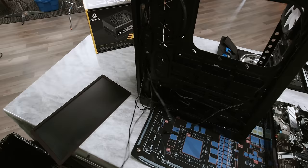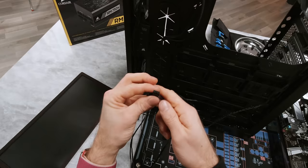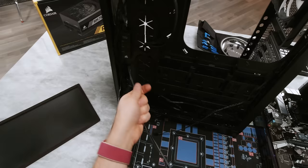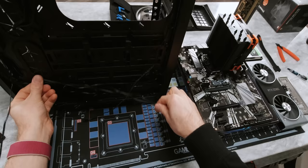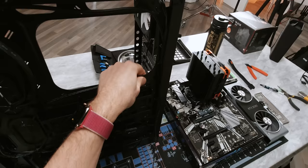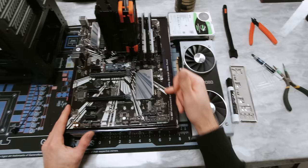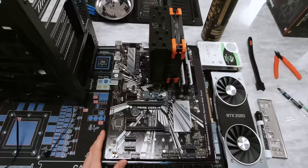What I'm doing right now with the fans is I'm kind of untangling the wires, making it so that my RGB wires and my power wires aren't crossing each other — because the RGB ones are both going to go to the same place down over here in the bottom right, and power is actually going to come up across here. This is really important before you install your motherboard — you're going to want to scout out where the fan power connectors are on the board. I like to see them along the bottom edge here or the right bottom edge here, as that makes it particularly easy to install bottom or front fans. Unfortunately, this board being more of a value option has the fan connections right here.